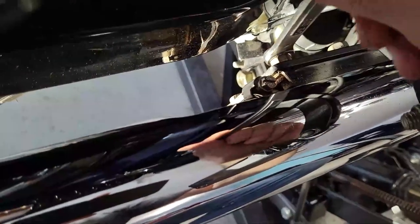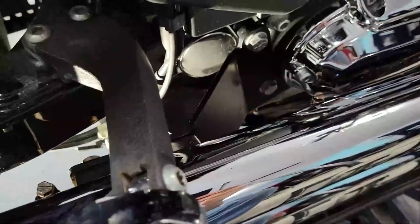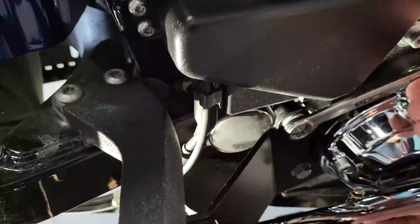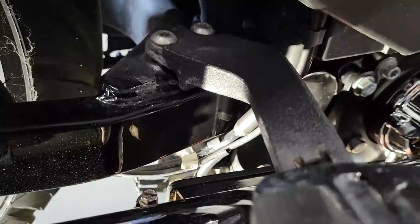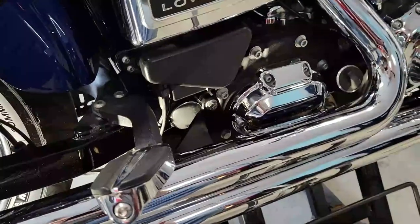There are four bolts holding the exhaust bracket and I'm checking each of those. Another thing to check is where the exhaust connects to the engine — the studs. When I first got this bike, the nuts on the studs were loose. I put an acorn nut on after the regular nut, tightened the two nuts to each other, and they've never come loose. If something has Loctite and you need to redo it, you have to take it all the way out, clean the threads, and redo it.